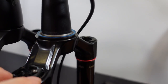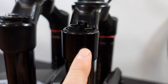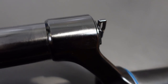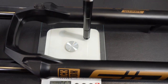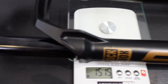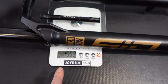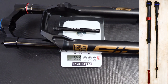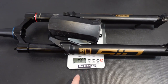That brings me up to the CSU, which is nicely sculpted again versus previous forks. If you look carefully at the Ultimate you'll see that the top of it is actually machined compared to the SELECT — I'm sure that was done just to save a little bit of weight. And talking about weight: 1553 grams for the Ultimate with the thru axle, 1515 grams without the thru axle. That's with the 6.5-inch steerer and crown race already installed. That 1553 is pretty much 150 grams lighter than the SELECT fork, with a big part of that coming from the weight difference in the damper. Add the little mudguard and you get 1583 grams — pretty impressive for a 35mm stanchion fork.